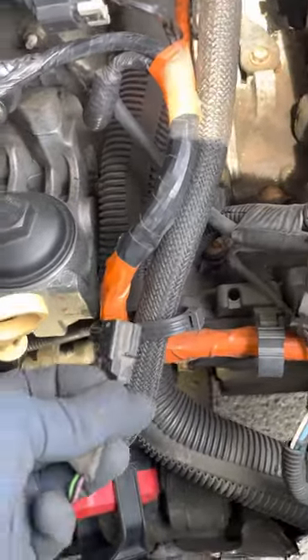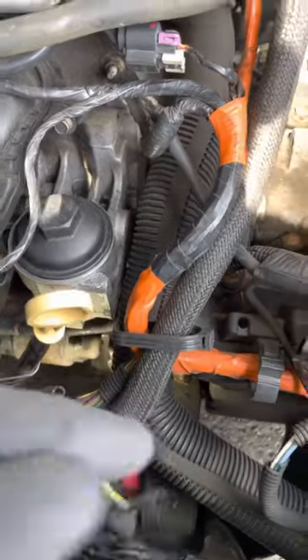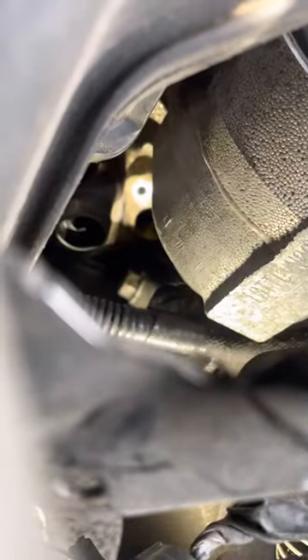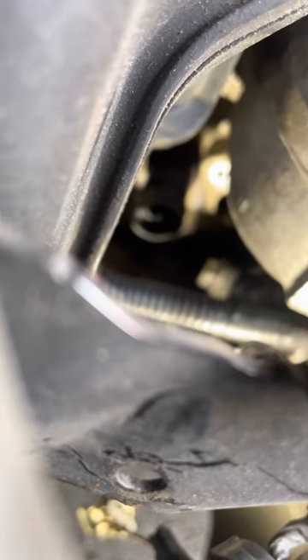It sits this way, so there's this little tab here — push the tab in, pull out. Once you pull it out of there, you see that hole back here. That's where the sensor is, that's where the 8mm is. You just stick your deep socket in there with the long extension, twist it out, get your needle nose pliers, pull straight out.